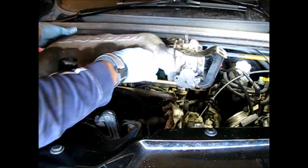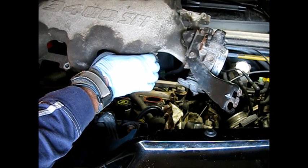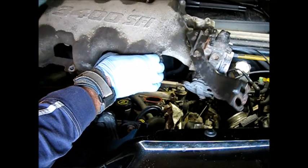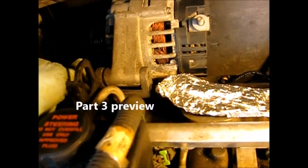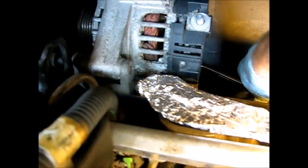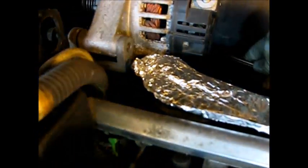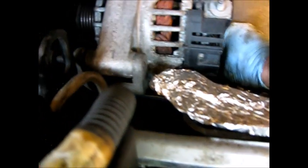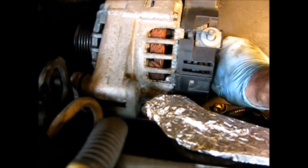Up and off with this upper intake plenum, and the multitude of components that are bolted on. That concludes part 2. Here's a little preview of part 3: we're going to begin by removing the alternator, then take the alternator bracket off, remove some wiring, unbolt the power steering pump and move it out of the way, then unbolt and pry out the fuel rail assembly, the crossover water pipe and hose. Stay tuned — thanks for watching.